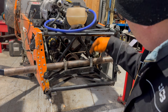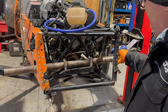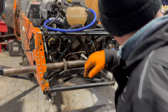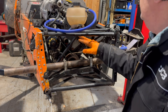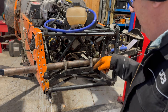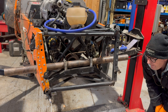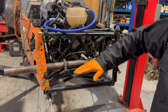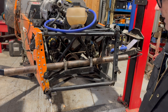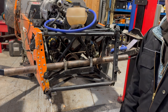Basically this bit has got to go up and that bit has got to go down. I've got this spreader bar — I don't know, we'll have a little look. I'll put some bars in because what I don't want to do is bend the chassis, I just want to bend this. That is triangulated there. Put a block of wood there, maybe with a little jack we can jack that down. There's definitely a split there and this is creased here — push that down, lift that up. Just like that, how hard can it be?